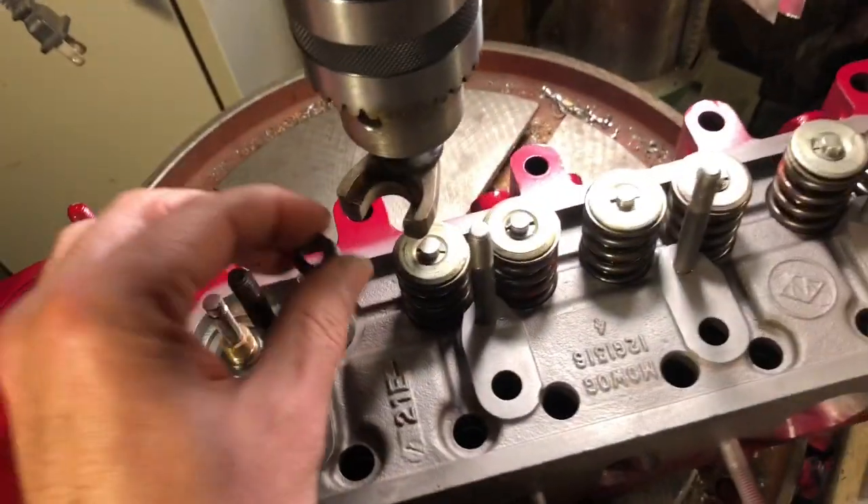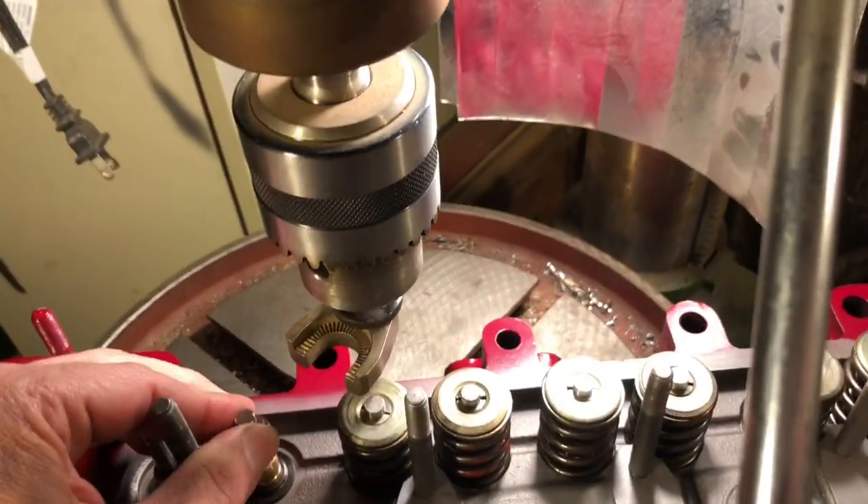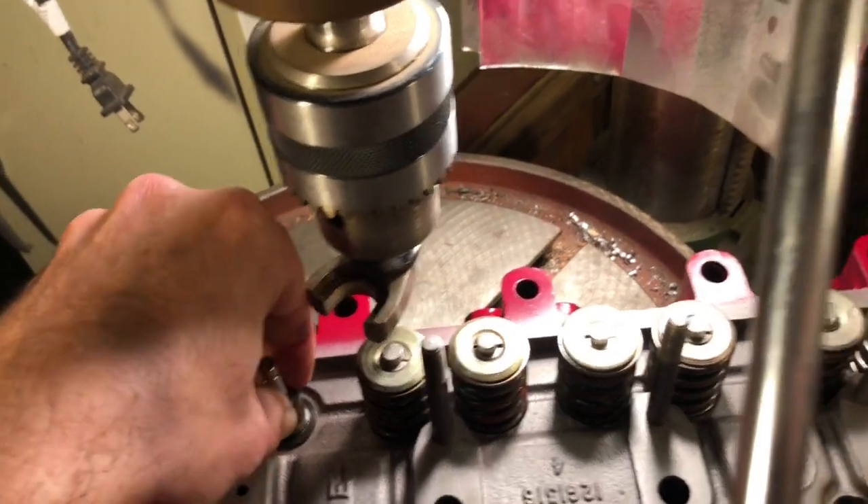But I have them lightly used here off one of the race engines — they're fantastic quality, so I'm putting them on. These are color-coded; those are the intakes. Slip that down onto the guide.